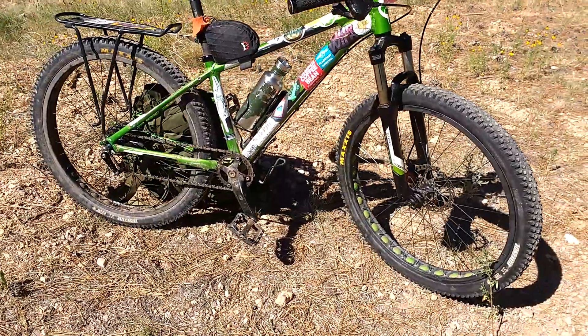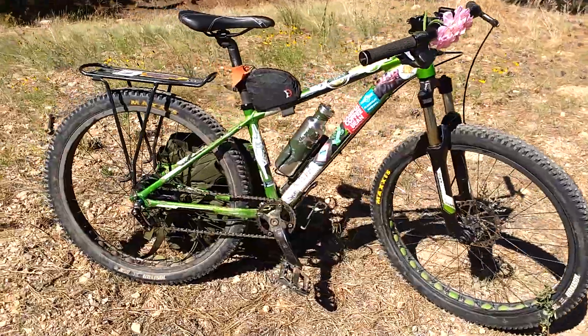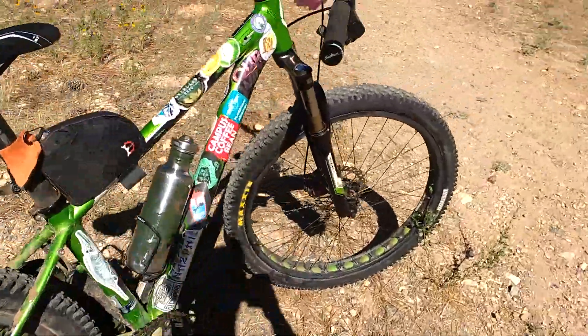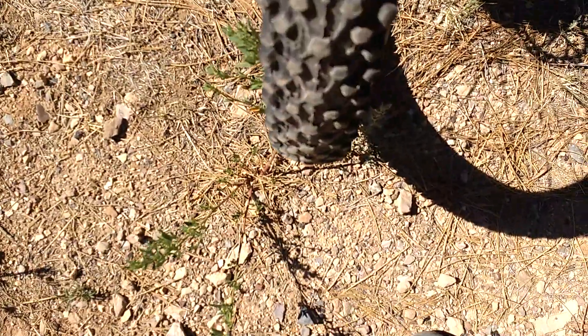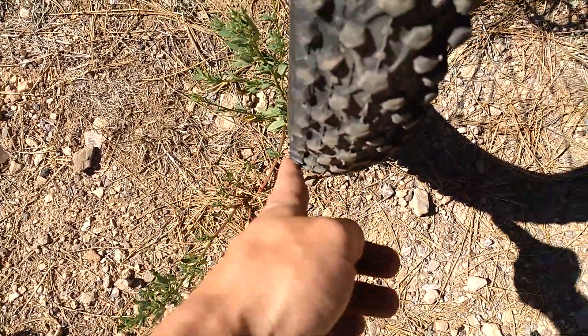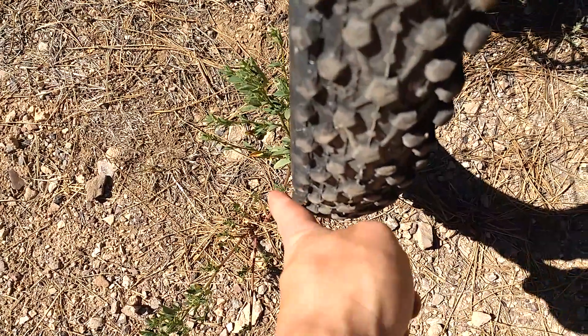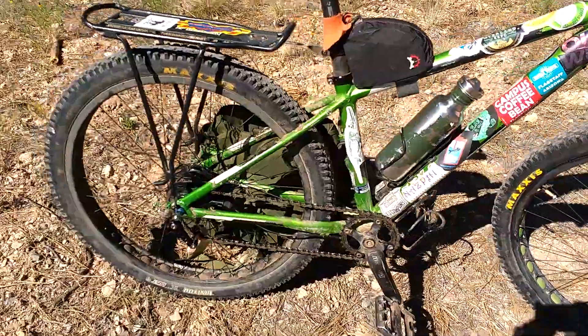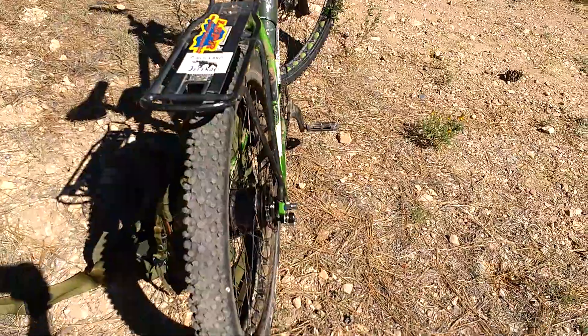What I've found is they're really good straight off-road. If you want to go through mud, they'll do pretty well for a mountain bike. But when you start cornering, it's a different story. You can see the profile of the tire here is pretty flat, so when you go over and start turning into corners a little harder, you end up riding on this corner edge. That's not a lot of cornering area — you can see the edges of these nubs are pretty worn off. It gets kind of unnerving when you start leaning over in the corners a little bit more.